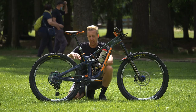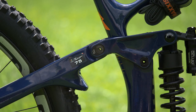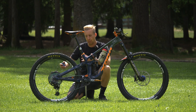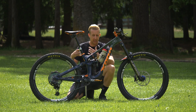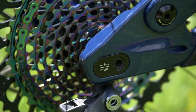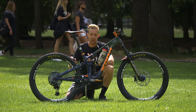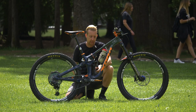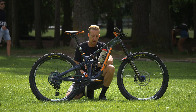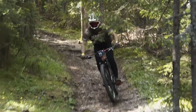On the rear of these bikes, you can actually adjust them to have between 29 or 27.5 inch wheels. There's a chip, so it's purpose-set up to run 29, but you could run it as a mullet style bike with a smaller rear wheel, although that doesn't make sense for the way Kona rides. He's also running the chainstay currently in the shorter position, about 440mm, and he does change between settings — but to do that he needs to change the suspension settings. A little more leverage the further the rear wheel axle goes, so you compensate with the shock setup. This is what he's running here in Val de Fassa, Italy.